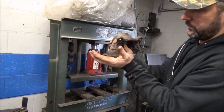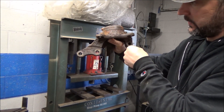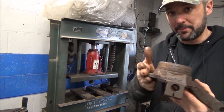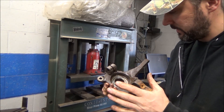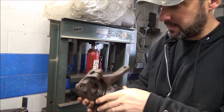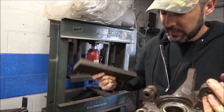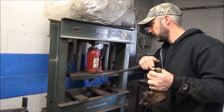So what we're going to do is set up on where the strut bolts on here, and then we're going to see if we can block it up under where the ball joint goes and give it a little push to see what happens. You still have to be cautious doing this — these are the two meatiest parts of the whole thing. I definitely wouldn't want to support it on the tie rod portion or on the brake caliper bracket. If that doesn't seem to work, we'll stick a flat bar across the middle here to at least get the bearing moving first. I think we will — stick a bar across here, get the bearing to pop free, which is always the hardest part, and then we'll drive it home by standing it up on edge.